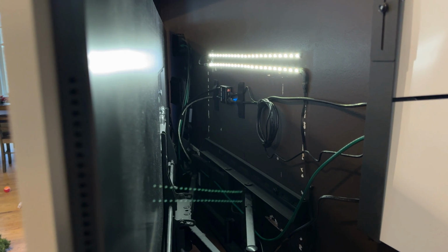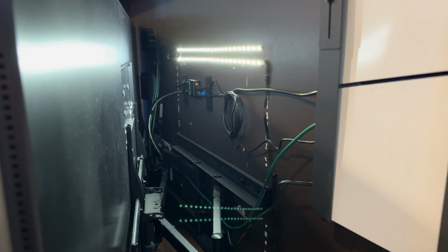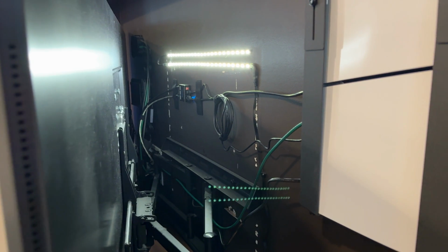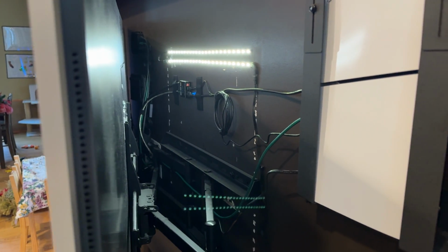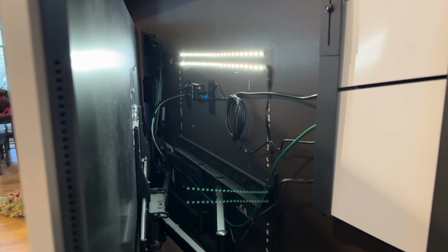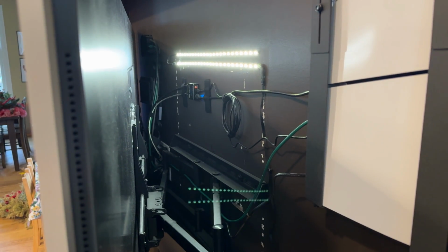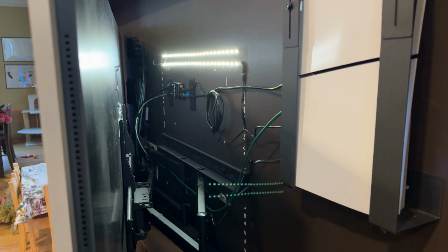Now I am using the fixed EDID on the EZCOO splitter there, and because of the limitations of the JVC projector, I am limiting the capabilities of the PlayStation 5. It's set up for 4K 60, 18 gigabit HDMI max bandwidth. It is doing Dolby Atmos, which is cool. That means I get the full capability of the sound in my theater room, but I'm not using VRR. I'm not using the 4K 120, unfortunately. It means I don't get the cool 40 FPS modes that games are capable of on the PlayStation 5. If I were using an upgraded projector, like say an Epson LS12000 or a JVC NZ series, then I would in fact be able to swap up to a different EDID setting and be able to do at least the 4K 120. Of course, still no VRR. We don't have that in projectors, but that's the setup.